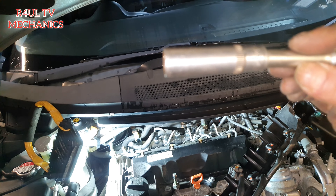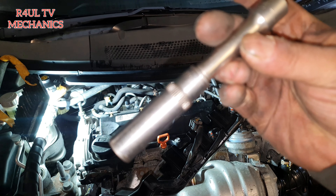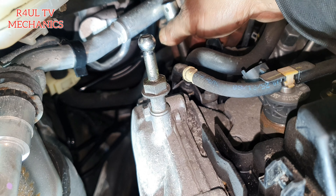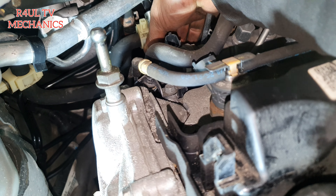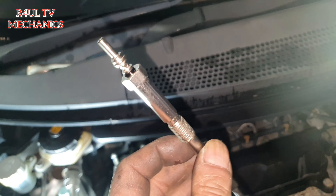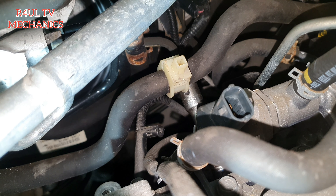The next thing you're gonna need is a 12mm deep socket and a little extension to go with it — I'd say a two-inch or two-and-a-half-inch extension. We're gonna get that in there onto the glow plug. You need both hands really — one hand to feel where the glow plug is, the other to put the socket on. One way to confirm the size: the new ones I've got here have a 12mm head, so the old ones should be 12mm as well.